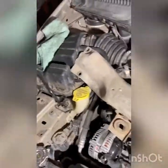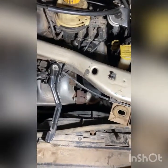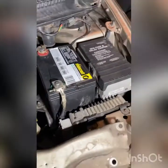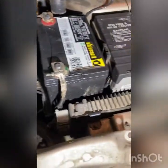Well, I took off that bridge, but you know, maybe I should disconnect my battery terminal just in case. I don't want to short anything out when I start disconnecting the fan and stuff. All I know, it's always good to disconnect your battery. So I'm going to take the terminal off. And by the way, they were 13 millimeter that held this metal bar.